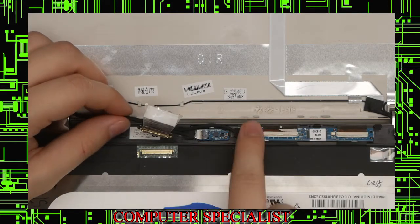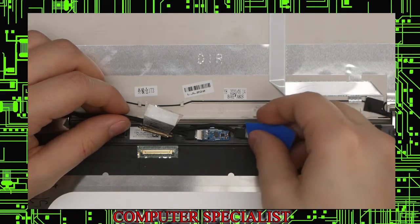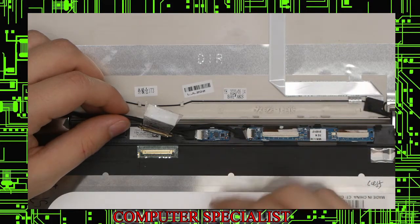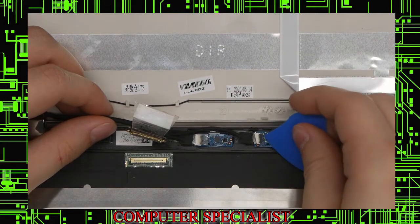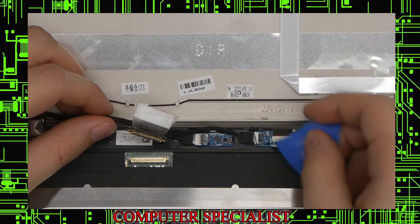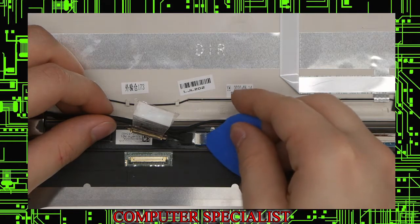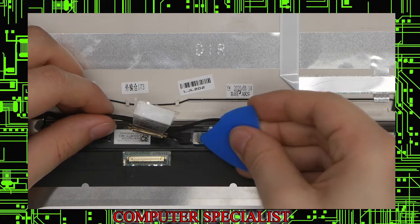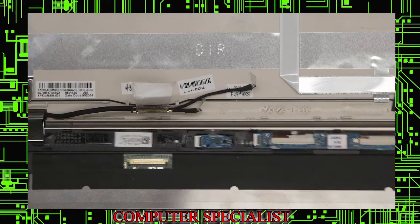It's still attached here and here, so we're going to peel the plastic just like we did with the other one. These two are a little bit different — these are locking ones. In order to unlatch it, you just lift up that little black tab, it will fold back, and then you can just pull the cable out. We have one more here — same thing: pull the tape back, lever the tab up, and that will pull right out. Now the screen is completely detached.